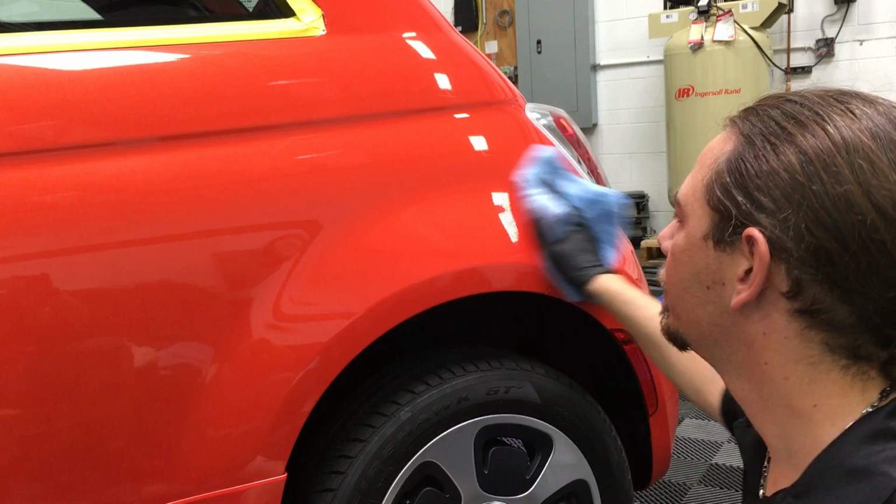And then we'll hit it with the LED. We'll get in a little closer. Camera handoff. So again, lighting plays an issue too. Under overhead lighting, everything looks perfect on the entire car. But you really want to check this under direct LED lighting if you really want to be particular about it. But as you can see, that one polishing step pretty much took care of all of that marring. Left it nice and glossy.